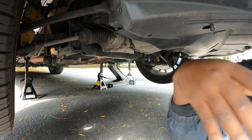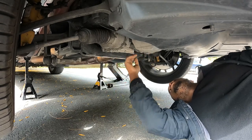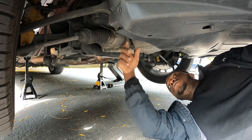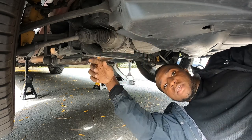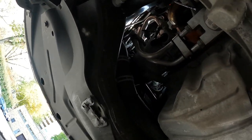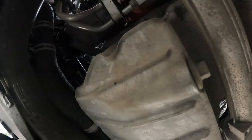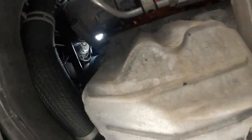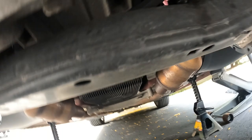This is the shield plate so you won't hit the subframe or the oil pan. The oil pan drain is here, I'm gonna drain it, and the oil filter is right here — it's a Mopar filter. I wanted to get another Mopar but I got a K&N filter. This drain bolt is probably a 13 or 14mm — yeah, I'd say a 13 or 14.